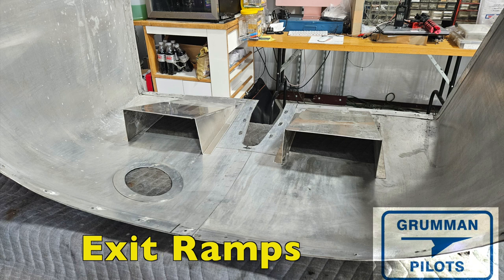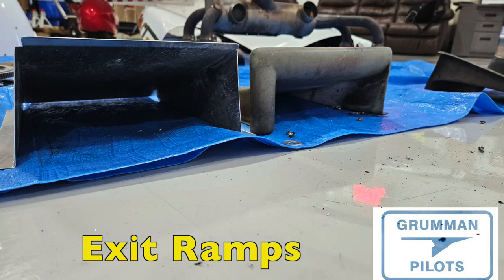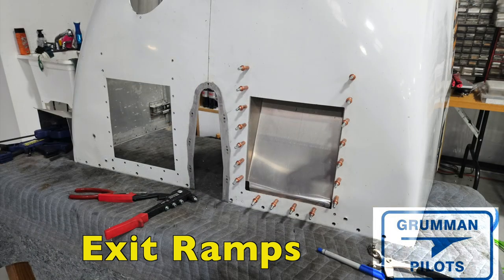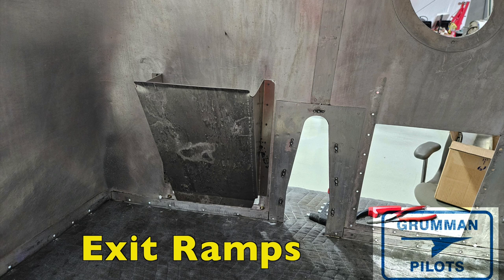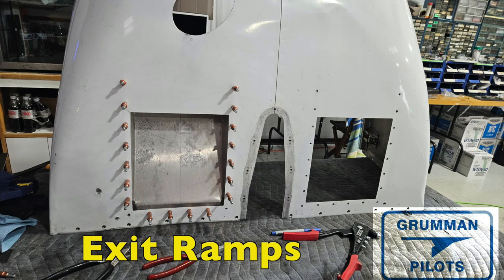They offer room for a lot more air to get out for cooling. The general rule of thumb in cooling an aircraft is for every one square inch of intake, you want three square inches of exit for warm air to go out. On our Tigers we have two-to-one — two inches out for every one inch in — so we're behind the curve. The larger exit ramps will let a lot more air out, forcing air through the inner cylinders more effectively, which is where you get your real cooling on the bosses by the exhaust. Everything has been match-drilled and held in by clecos; we'll do the same with the other ramp. Then they'll be acid etched, alodined, primed, and painted — we don't want any corrosion between bare aluminum.